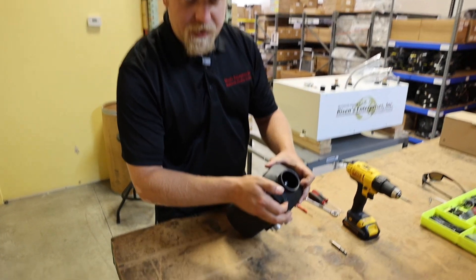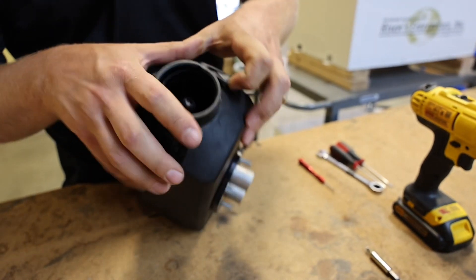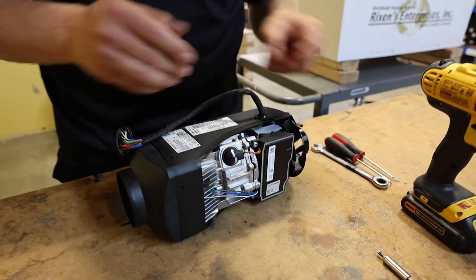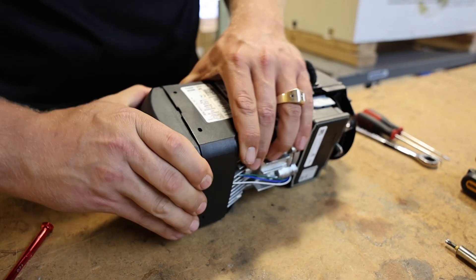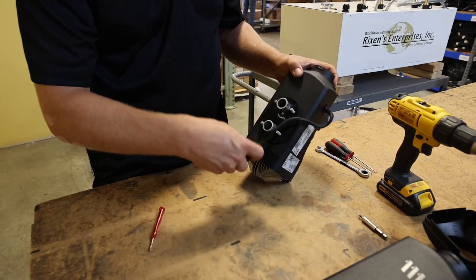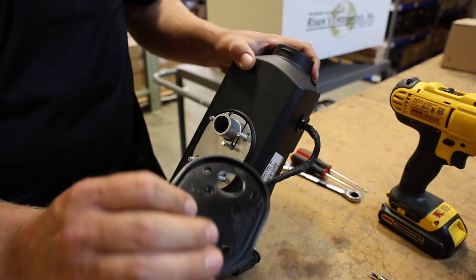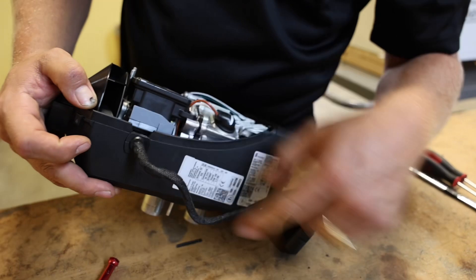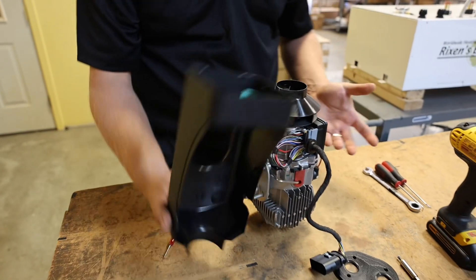First thing you're going to do is there's a couple tabs, so you're going to pull up on these tabs lightly. If it's been a long time and they're hot and cold a lot, you might break the tabs — you got to be kind of easy with them. Once you remove those tabs, get into the little notch there and you can kind of pry this cap off. Get your top cap off, then peel this rubber grommet. Sometimes if they've been in service for a long time, this will kind of get melted down, but try not to damage it when pulling it off. Once that's all off, you have one more rubber grommet here that holds the wiring harness into the housing. Slide that up and the whole outer case will come off.